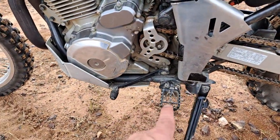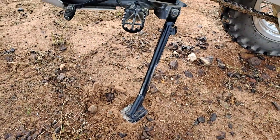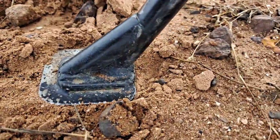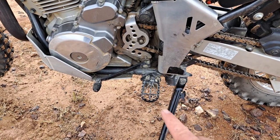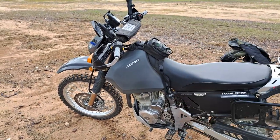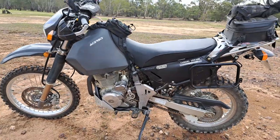I've also got the Pro Cycle lowered pegs and I've had a friend do a modification on the side stand — just welded a larger plate on the bottom, which works really well particularly in soft sand. Just make sure the back of it doesn't rub on the swing arm when folded up. The Pro Cycle lowered pegs work really well and help create that ergonomics triangle — more distance down to the pegs. Combined with the Wyndham bend Pro Taper bars bringing the handlebars up about 50mm, I can now stand on the pegs with just a slight bend in my arms.